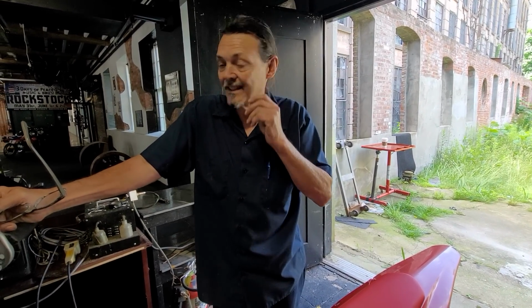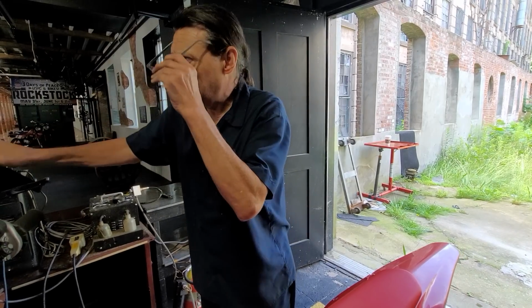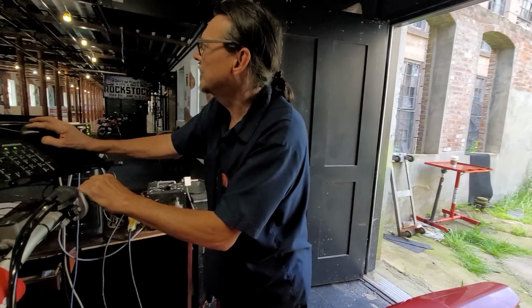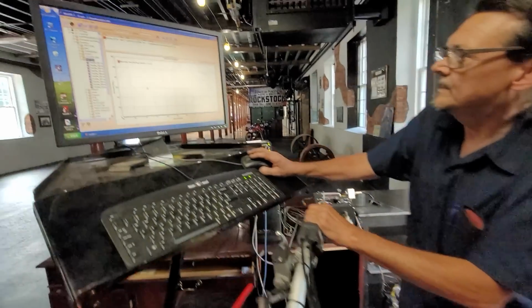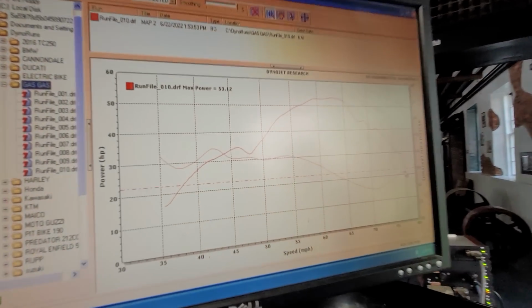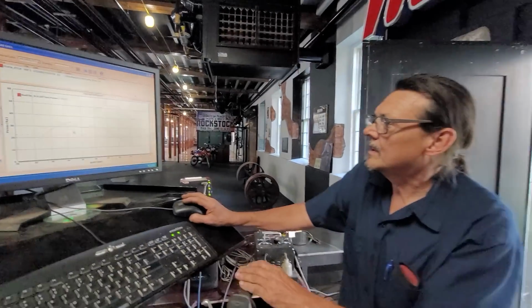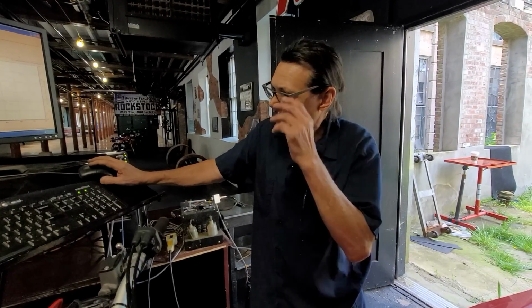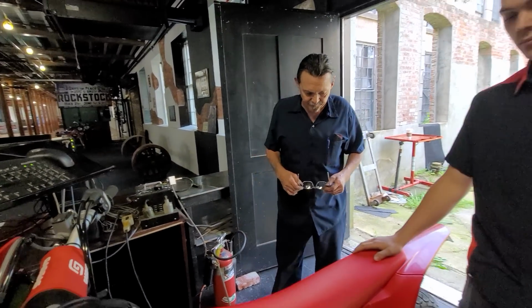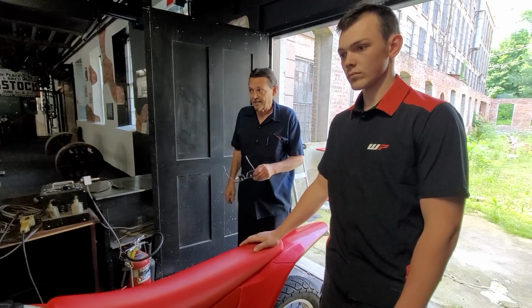What was the change in map 2, Jeff? Well, I don't remember if he said map 1 was richer and map 2 is leaner. I think he said map 2 is richer. It's meant for higher elevation. I can tell by the fuel. Which one did it come in again? It came in map 1. Oh, map 1, so okay, let's look at the fuel there. So it has a little bit more fuel. It's definitely leaner down low, and then it dips down, and then it finishes off at like 12.8. That's about where you want it, right? Yeah, it's much cleaner and comes on better with this. Can't wait to ride it with this one. I rode it with the other map. So that's the best map. Let's leave this one in here.